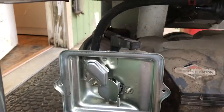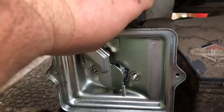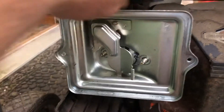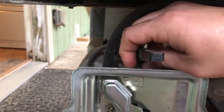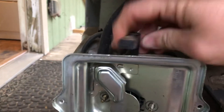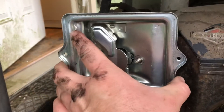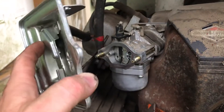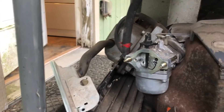It tells you to rotate it all the way to the right and pull straight up, and that handle ought to pop out. All the way to the right, full choke — it'll pull straight up. Once we've got that out of the way, pull that cover. It's got a breather hose attached, so just gently set it out of the way.